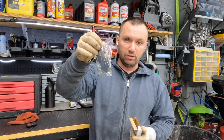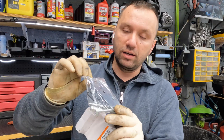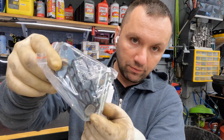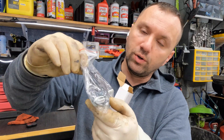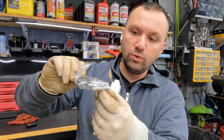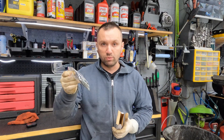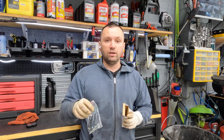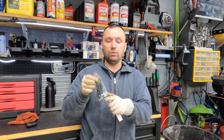I keep these in the shop because we run through two or three of these a month. In the package you'll pull out your little bag, and you have your sandwich plate — flip it around and you have your two gaskets: one with a screen and the other is just an O-ring gasket. They also give you the three bolts and hardware you need to replace it. You simply unbolt the VTEC solenoid or spool valve with the three bolts, get it out of there, and install the new gaskets, new sandwich plate, and new hardware.